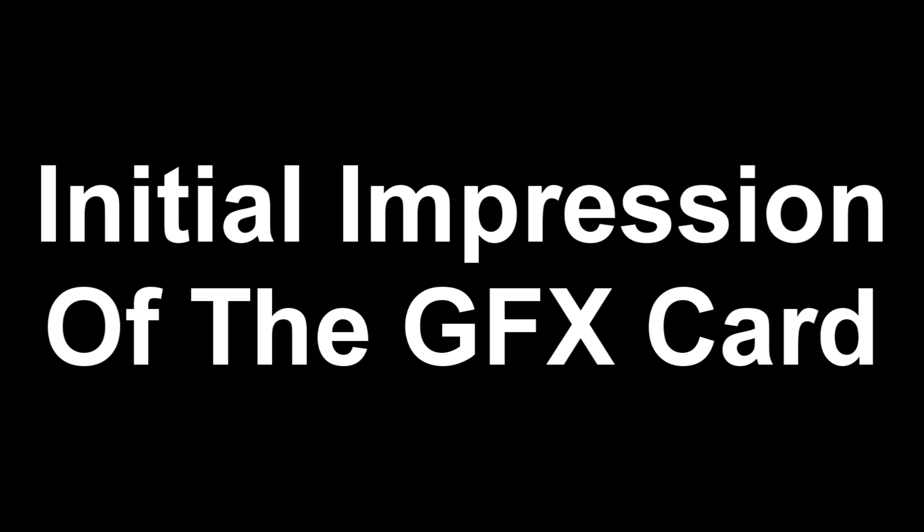My initial impression of this card is it's good. It does seem to have a little high-pitched whine when running at full capacity. I've got the Folding@Home GPU3 client for NVIDIA cards, and after it's been running for a bit it does tend to squeak a little. That could be the fans or the actual GPU — I'm not sure. If the temperature gets to about 60°C the whine starts; below around 40°C it's not there. But it's very powerful — I don't really care about the whine.